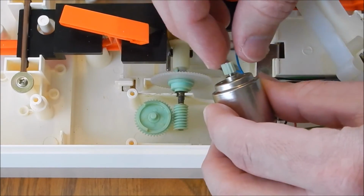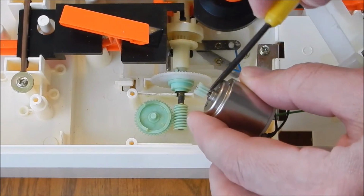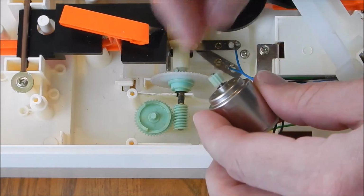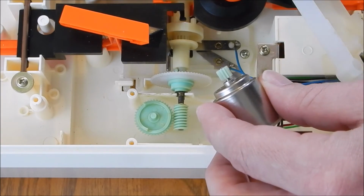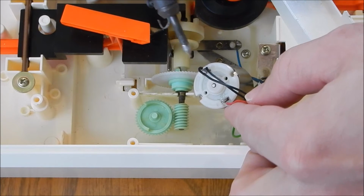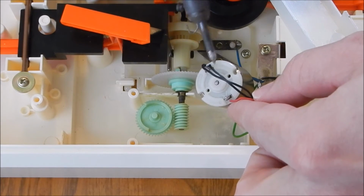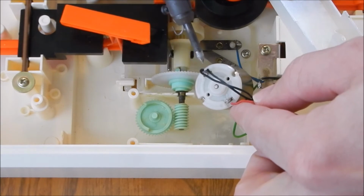And you're going to have to remove this gear. Just take a tool and slowly work it up. Just pry it off the motor. There are other videos out there, and I'll put a link in the description on how to do that. There's a great video somebody did on how to do it. This one's pretty simple. Okay, so don't always trust the color coding that red is positive and black is negative. That's why you have to use the battery test that I demonstrated in my other video, and actually look at the back of the motor. Sometimes it has positive, negative symbols. Some motors don't.